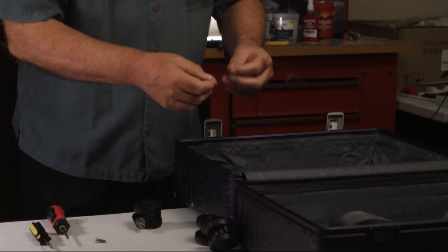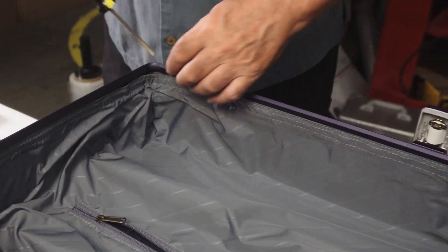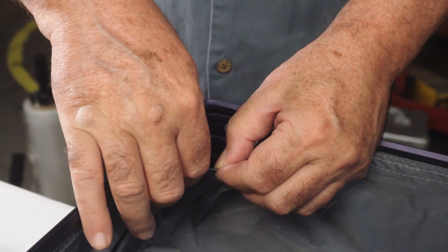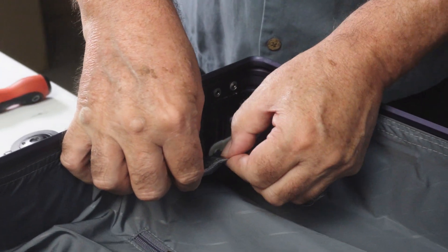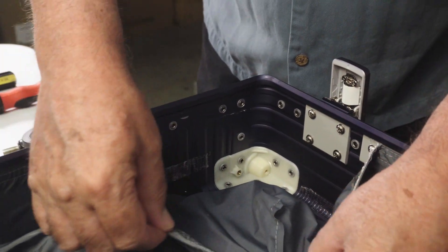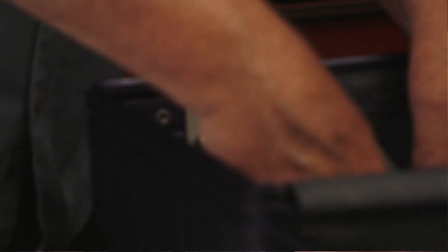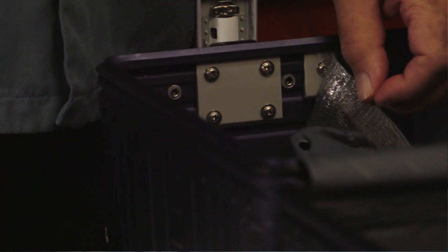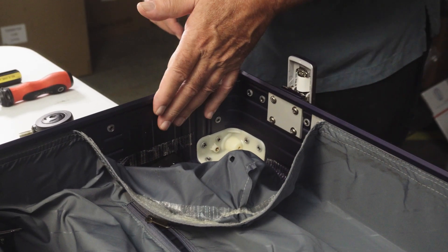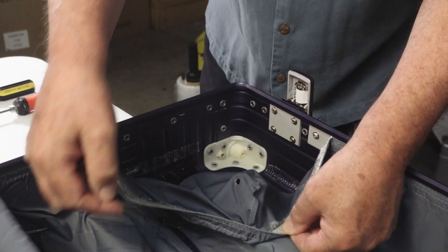Here's the clip that I removed from this side. The second thing I'm going to do is take my flathead and very gently, I'm going to pry the lining away from the edge of the case. You want to be very careful and not crimp the lining. This is double stick tape — it's very strong and does a great job keeping the lining nice and snug against the case, but you just have to be very careful not to crimp it.